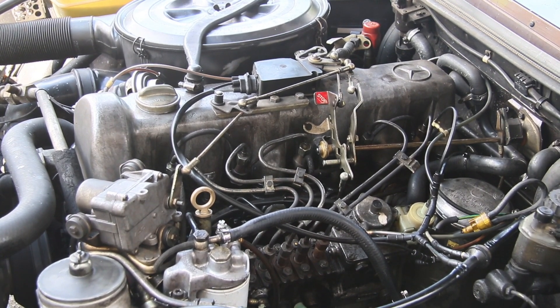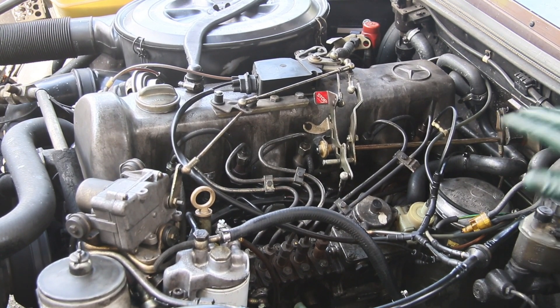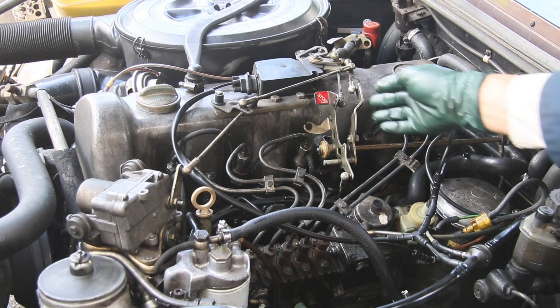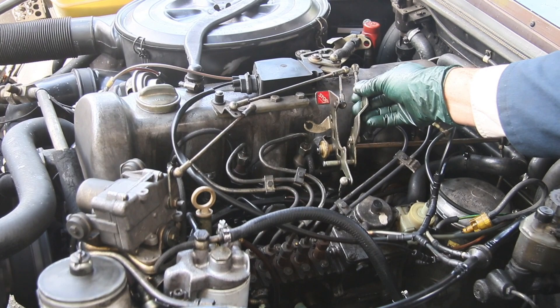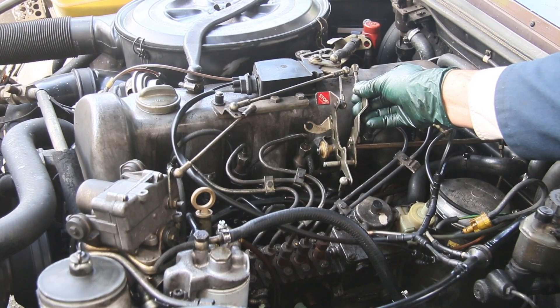I don't know how long or what type of fuel is in the tank, so that's an issue. But what I want to do now, before I start considering valve adjustment — I know I need to replace the other fuel injectors — I just want to go back and see if I can find which cylinder is missing, or if this is more of an intermittent type of rough idle. I'm going to increase the speed and then crack each injector line to see if we can isolate which cylinders are misfiring.